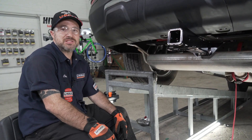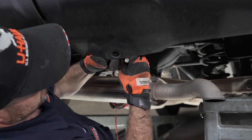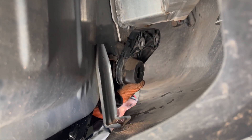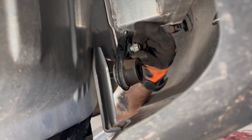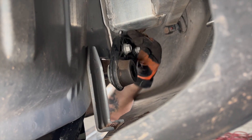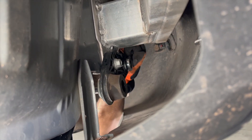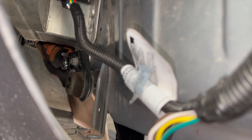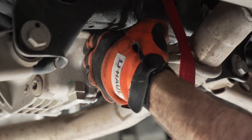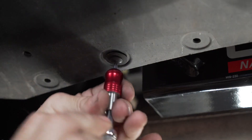We are now ready to reinstall the exhaust brackets. Let's go ahead and again gently pull back on the fascia and get our exhaust posts back behind it. Now place your exhaust bracket over the exhaust post and then hang it on the flange. You will need to push up on the exhaust to hand thread in the previously removed bolts. Once hand tight, tighten down fully with a 15 millimeter wrench — tighten snugly but do not over tighten. Repeat for the other side. Reinstall your final rubber isolator and remove the strap. Now reinstall your two fascia screws with your T15 Torx bit.